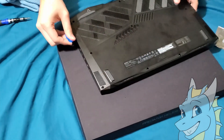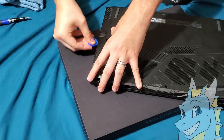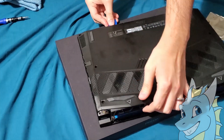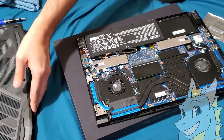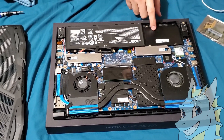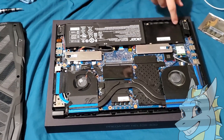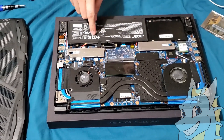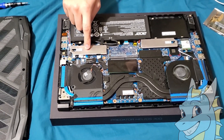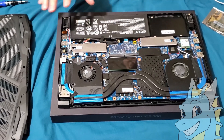Now this is open — it's super easy like that. Here we have all the inside components. Since this laptop came with an additional hard drive bay, you can upgrade it by putting a SATA hard drive here because they include a cable and bracket so you can add another hard drive. The cool thing about this model is that you also have a secondary SSD NVMe M.2 drive slot, so if you want a super fast SSD NVMe you can put it in this second slot. But that's not what matters today.